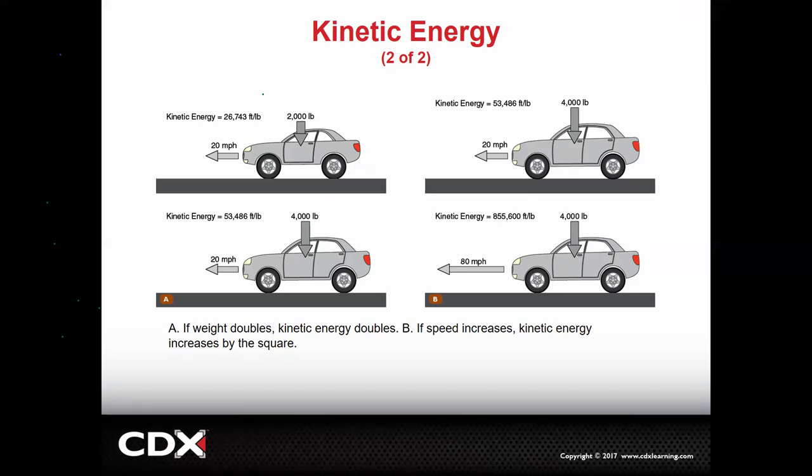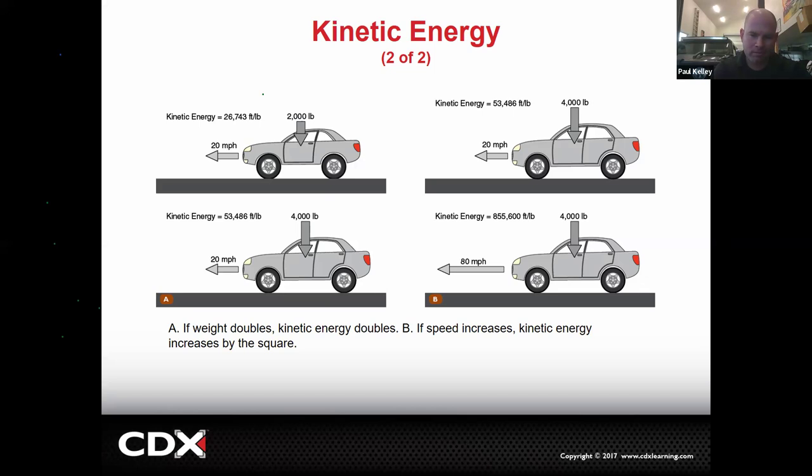Big Brembos. Big. Now, what if it was an LFA that could do 179 miles an hour? Now we need big, big, big brakes, right? So while trucks have big brakes because they're heavy, supercars have huge, huge, huge brakes because they're so fast, they make way more kinetic energy than even a big heavy truck. Cool. So that's why when we get into performance stuff, you're looking at massive brakes, carbon ceramic rotors, huge venting in the fascia and the bumpers and in the fenders. Because all that heat needs to get out. So we'll actually design the body in a way where we can manage that heat. So it's kind of interesting.